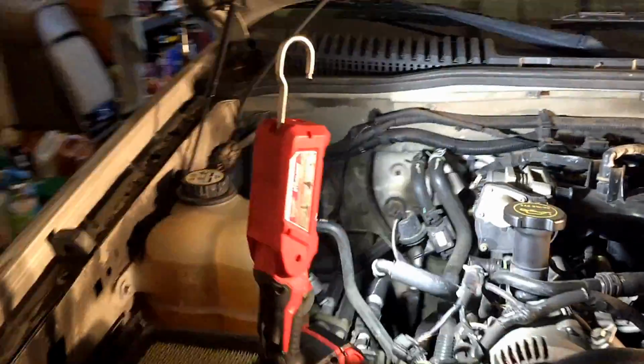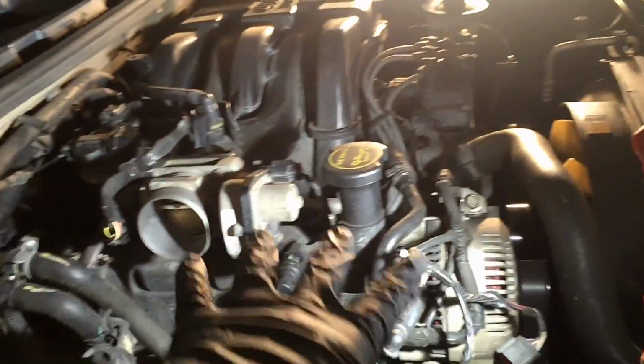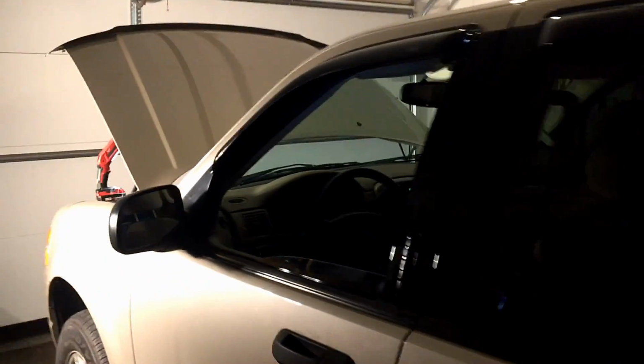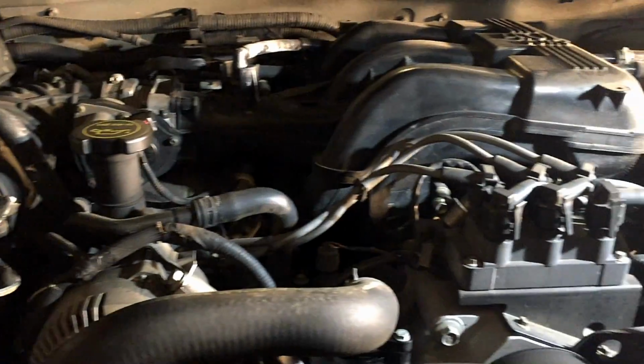Okay, at this point, we'll go ahead and put the rest of the intake back on. It wasn't that bad, but like I said, these early models don't have that sludge compensation strategy. So now it's nice and clean. Everything's back together. We'll get the intake snorkel back on here, clear codes, and let it run and learn the throttle body. Let's do it. Running really good, so we'll let it run, learn the throttle body, and test from there pretty much.